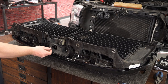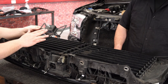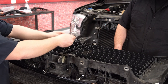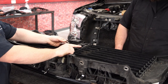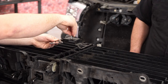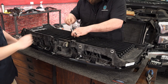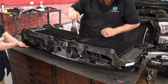The next step is to install your shutter assembly and get your wiring popped through. All three of the wiring connectors are popped up through the hole, ready to install the harness once we get everything bolted on and put into the truck. Note that this center piece is actually a centered grill support for the entire thing, not just a camera bracket. You're going to lean your shutter assembly up and this is going to go right on there with the bosses towards the bottom of the grill. Use the included 7mm screws to go into all four of those, and then the larger bolt will go right through the shutter assembly and thread into the hole. The first bolt into the shutter assembly is included — it's a 10mm with a larger flange — and that goes right into the center bracket we just installed, which has a nut welded onto the other side so you don't need to hold anything.